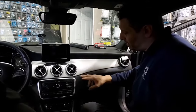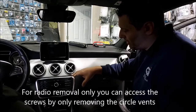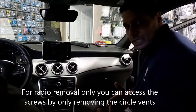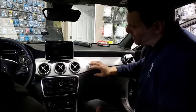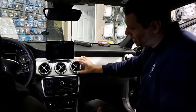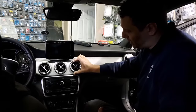This radio has two screws that are hidden behind this area on the top, and when you open those screws it will allow you to slide the radio outside. To reach them we have to open this air vent area, and then we have to remove the screen so we won't have any issues getting to that air vent area.